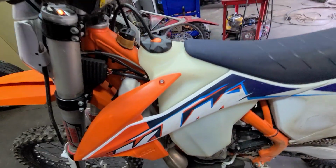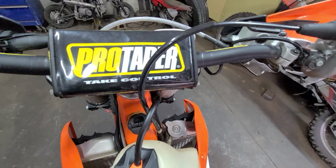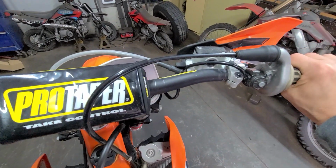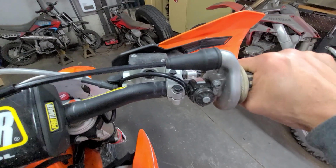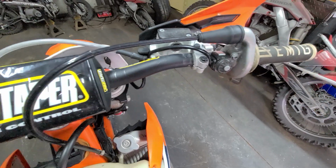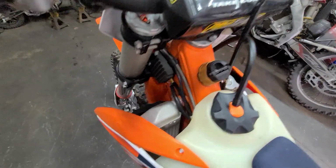The other thing I did is I got a really sore wrist in the last race from really cranking on the throttle. What I've done is converted it to just a single cable on the throttle body and put the quicker cam in the throttle, so it's only really about 1/8 of a turn to full throttle. It may sound pretty aggressive, but it's not. When you ride it, you just compensate for it, and it's really good.